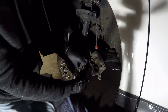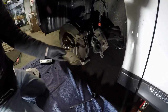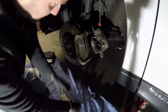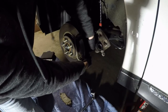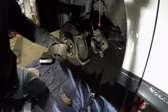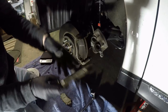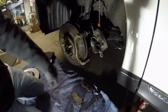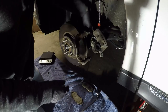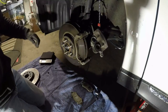Just lower it a little — it's out of the way. Remember the basics: keep your pads in the right place on a towel as you take them off. This is the outside pad, it'll go out here, because you have different pad clips. Only one side has a squeaker. This is the inside one — you can also tell with the markings. Just stand and practice: put the pads on the side where you got them off. The caliper carrier is going to be 17s, so let me go get that set up.